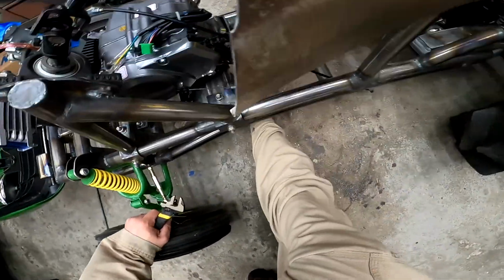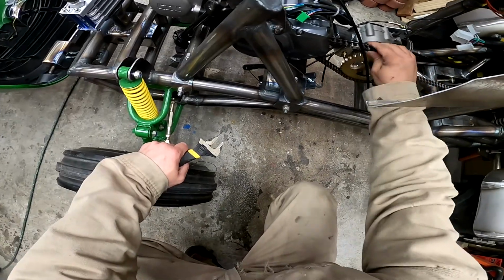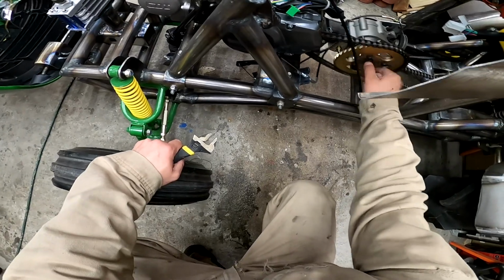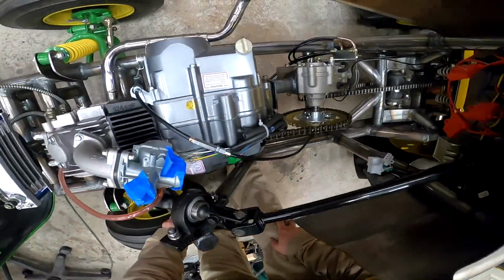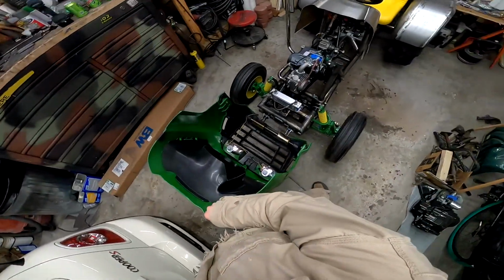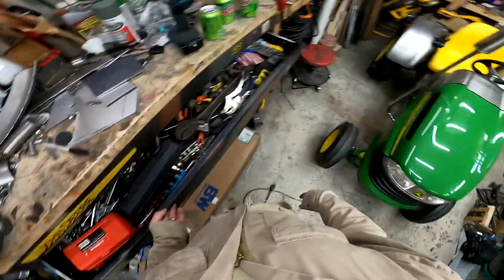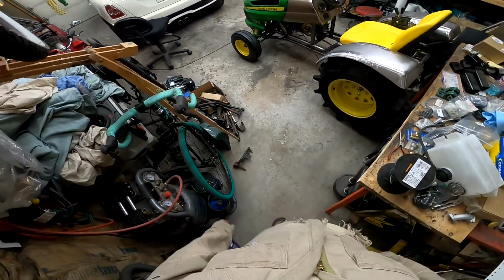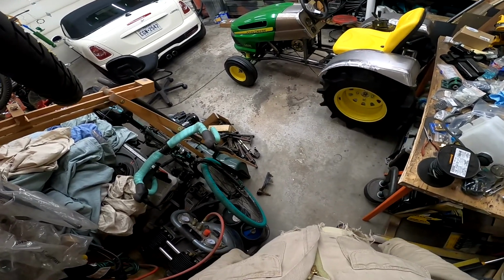And obviously now I have these in my way. I'll need to try and figure out my chain tensioner too now with those all in the way. This obviously isn't quite centered because you can see it's a little tighter and then a little looser and a little tighter and a looser. So no big deal. That's probably this gear when I had to drill up the hub for it. It's probably just not perfect. Whatevs. It works. It'll probably work without a tensioner too. But if I get to changing up the gears on it, then I'll need one. Because what are the chances I'm going to get it just perfect again with whatever gear combo I decide. So might as well go ahead and get that tensioner installed. So I might do that next before I get too deep.